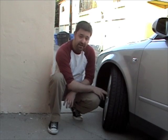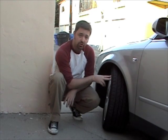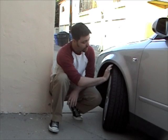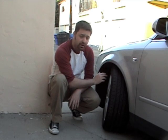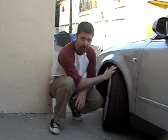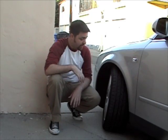The other thing you really want to check is your lug nuts. People never check this on the street, and it's one of the things that can cause a major accident if you're not careful. Just go in there, read the owner's manual, and make sure the lug nuts are tight — there's usually a tool for it in the trunk. Next, check the bearings to make sure they're not loose. Put your foot at about the top of the tire and give it a good push. It'll be very rare, but if you hear a thunk-thunk when you move it back and forth, that's the wheel bearings being loose — take it to a mechanic or deal with it yourself if you're able.